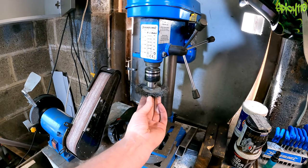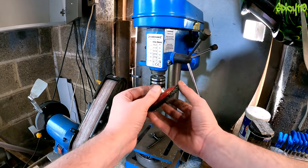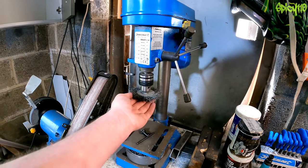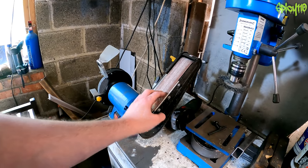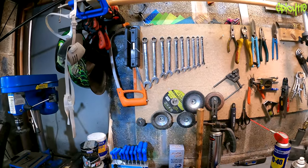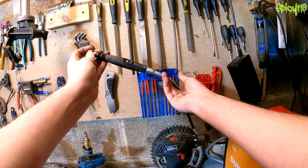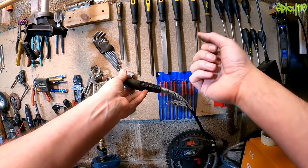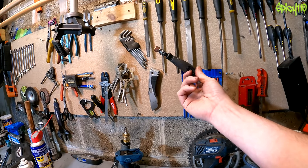This softer drill wire brush is good for cleaning rust off things without ripping them apart too much. If you use a wire brush on an angle grinder you will actually eat metal away, which can be good or bad depending on what you need. Even softer ones called carding wheels are available. A little belt sander is also very helpful, as is a little grinding stone. A hacksaw or angle grinder, clamps, and one last thing I'd consider essential for a motorcycle restoration: a rotary tool like a Dremel — invaluable for grinding little things, cutting small things, and cleaning stuff you can't reach with a bigger wire brush.